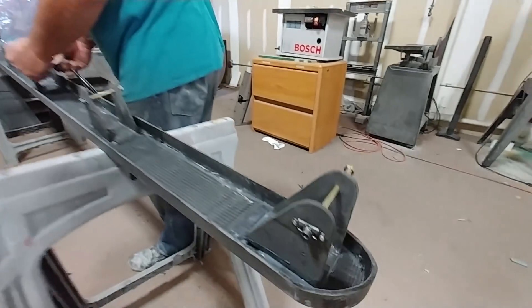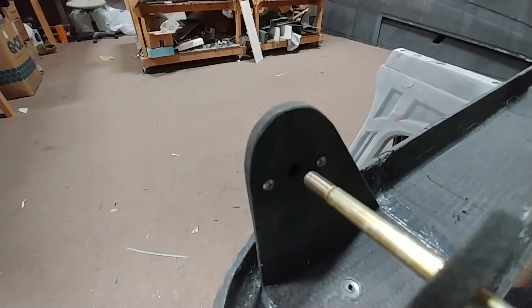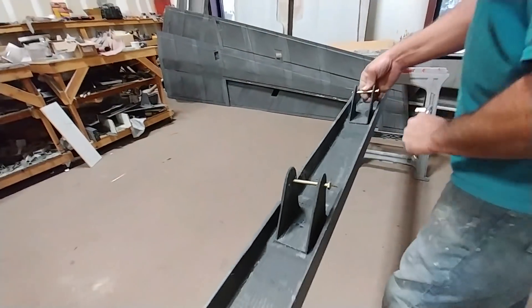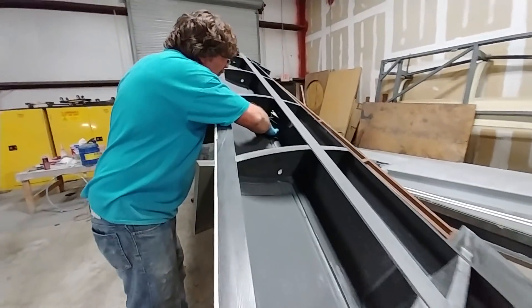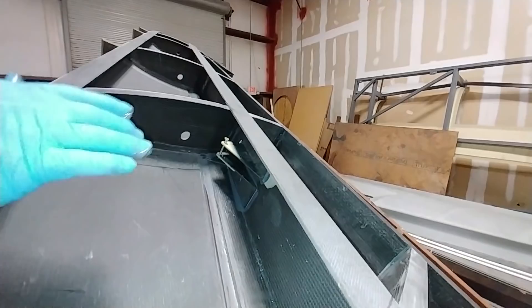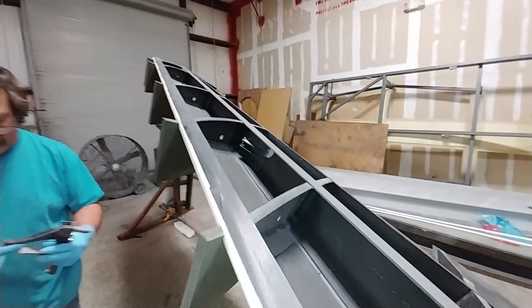Welcome back. Starting out the second half of the week, we have Jeff here installing the hardware for the hinge points for the bell cranks for the foreplane. He's just riveted on those floating nut plates and he's checking to make sure the hardware is lining up nicely. Over here he's in the process of bonding in the mounting plate for the bell crank for the aileron control — that's the one where the main rod comes through from the cabin and then the other rod actually actuates the aileron.